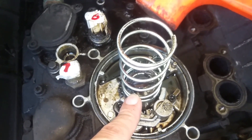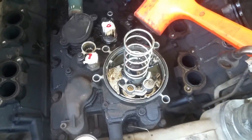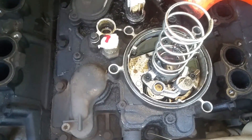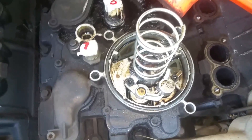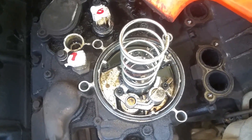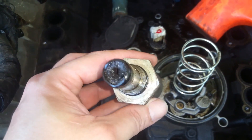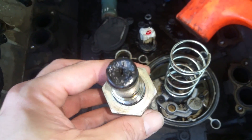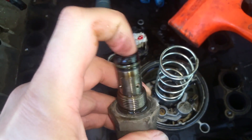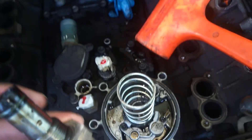At first I hadn't even noticed it. Along with that, the EGR was just completely carboned up — nothing could get through there. I'm just going to keep on digging. I'm suspecting there's a lot of other stuff that's going to be melted. This is the IPR and it's just completely clogged right there — nothing getting through — and that could be plastic as well, and it does feel like plastic.